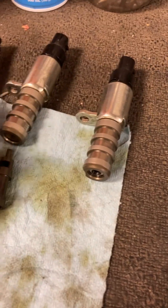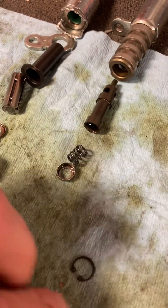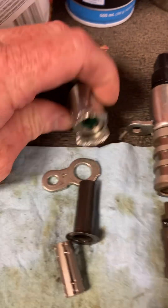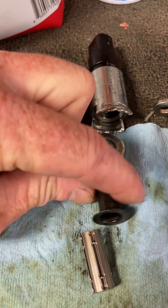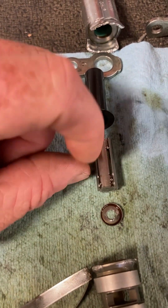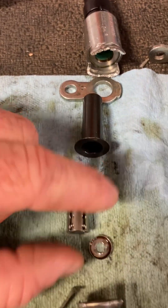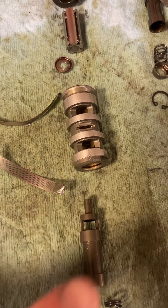This is what one looks like altogether. On this one I pulled the spool valve out — it's just got a little spring in there that keeps it where it wants to be when it's off, and a little retaining clip. I also took one all the way apart. This is the actual solenoid, which was fine. The retaining bracket sits inside the solenoid and contains the oil. The electromagnetic force moves the armature in there; that pushes on the spool valve and then lets it return — that's how it controls it.